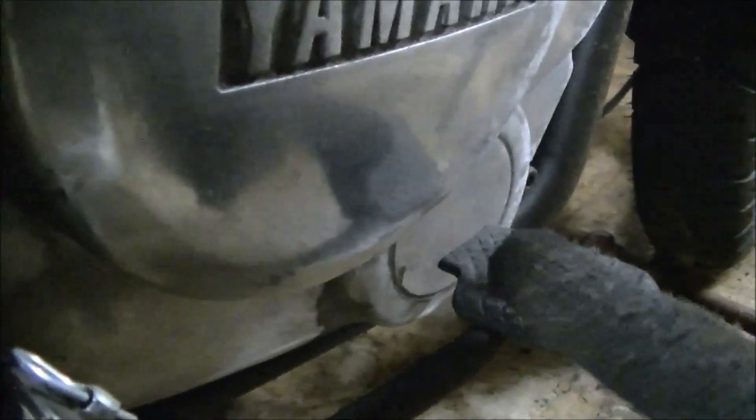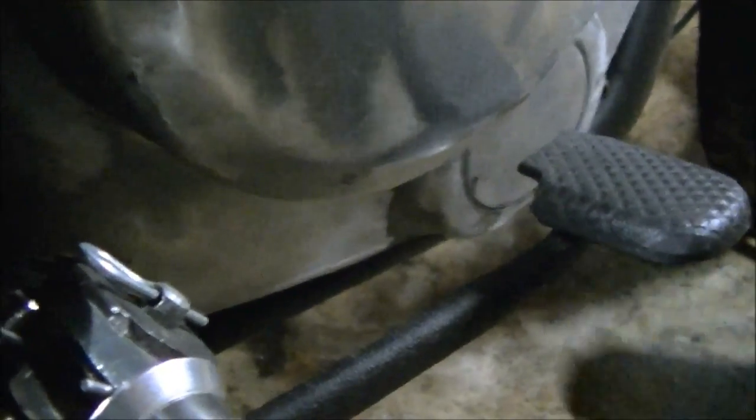One final point of adjustment I nearly forgot — right here, you see this bolt. When I push on the brake lever, it comes off the back of this bolt, and this will control the return height. The original owner had this thing returning so high that it was literally hitting the side of the case — you can see that mark right there. He had that bolt turned so far out that when you released the lever, it would actually go so high it was hitting the case. So that is controlled here.